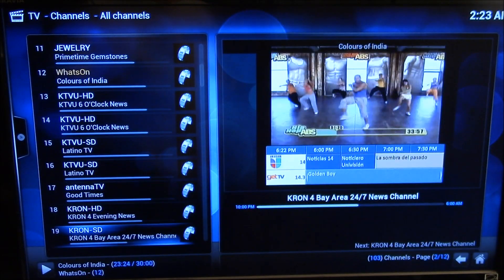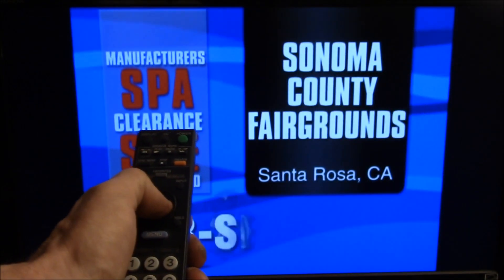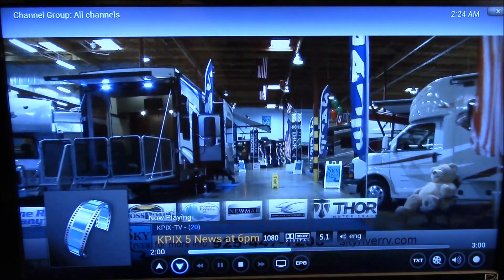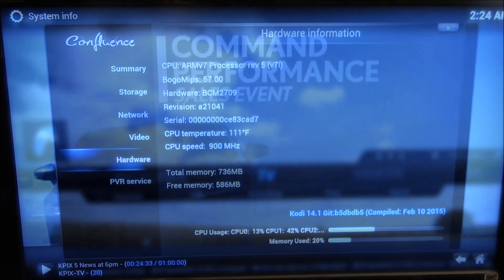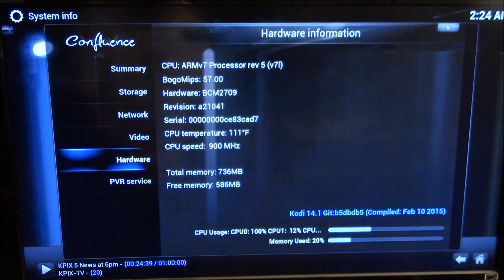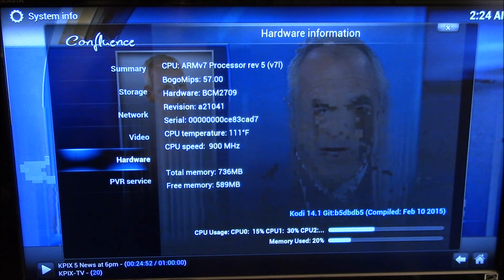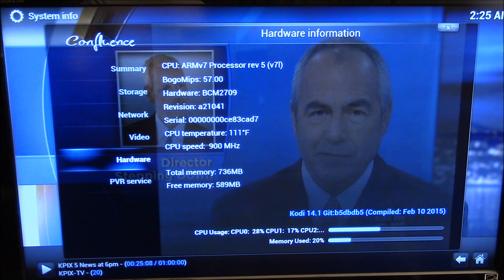Let's try 1080i — this one. So this is 1080i. From the main screen, if you do a plus, you can see down here we've got 1080 video, Dolby 5.1 audio. You can tell it's stuttering a little bit. Now we're at 900 megahertz. CPU temperature is going up a little bit. And we've basically maxed out one CPU at 100%. You can see how it's breaking up a little bit on the decoding. So I think it still needs the hardware decoders.